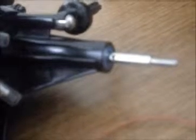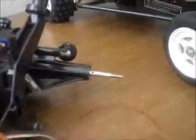My axle shafts are brand new Traxxas Cat or Spirit shafts. The bevels — the part that fits into the differential gears — needed just about a tenth of a millimeter shaved off, which isn't very much, just a little sanding. They plugged right into the differential gears very easily. Everything is all ball bearings all the way through.